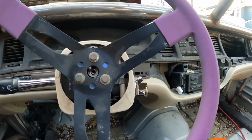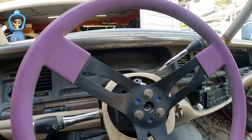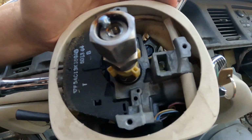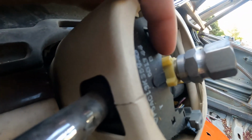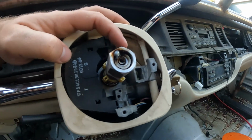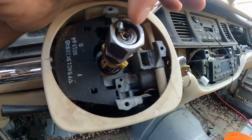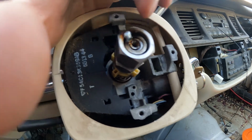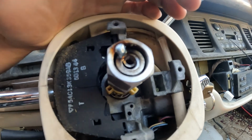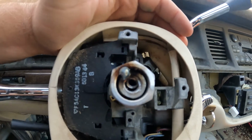All right, I got a little tack in there. Seems like it's going to be kind of where I want it. I'm going to take this off to show you. So what I did, when I pushed this all the way down up against here, we still had the clearance right here, but what I didn't have was a really good surface on the inside to weld to. So I pulled it out just a little bit so that I have enough surface to go around the inside here and weld it up really good so it's got good contact and will hold real nice.